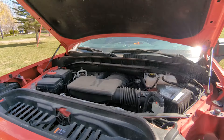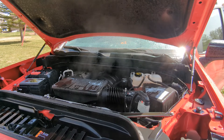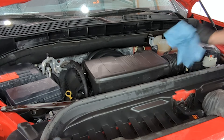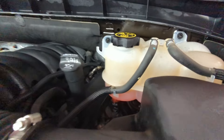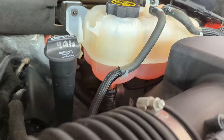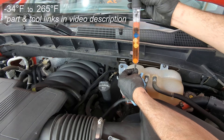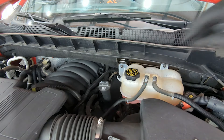I'm going to do a quick engine wash and clean up any leftover residual coolant I might have spilled. With the final level looking good, I'll take it for a drive, let the mix circulate some more, then come back and recheck the level and see what kind of mix we have. Capacity is still right — popping off the cap and checking the protection range: minus 34 to 265, which is ideal for Dex Cool. I appreciate you watching — please like and subscribe.